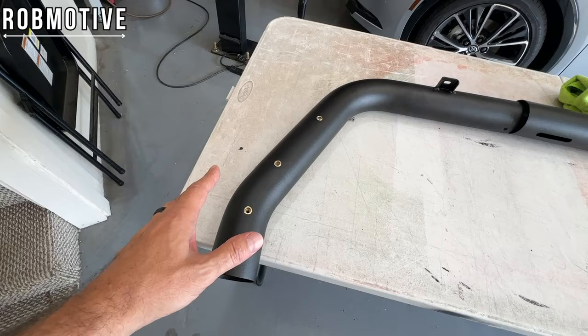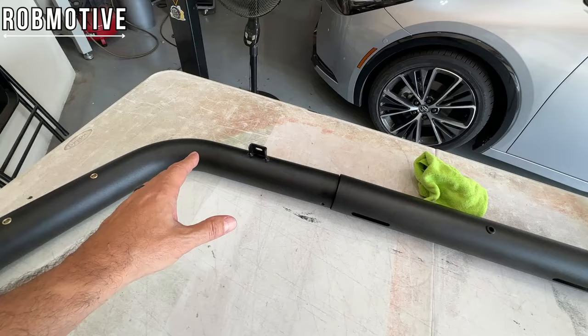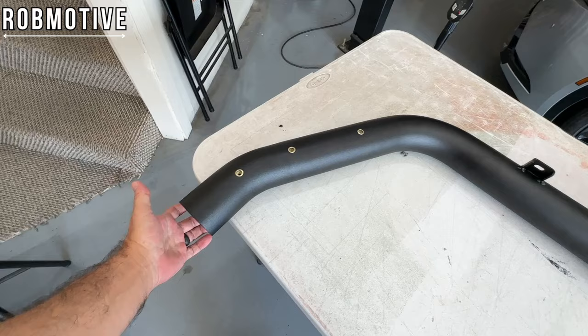Also, while I'm at it, I'm going to add some lights to the top of this thing. So I want to go ahead and run a couple of wires for power down to the side of the bed where I have wiring left over from the last set of lights I had on. So I have to run three wires through this hole, down the bar, and then out the back so that I can have it all ready to go before I put it together.